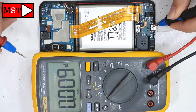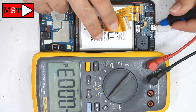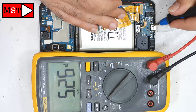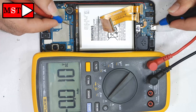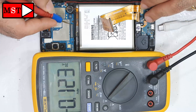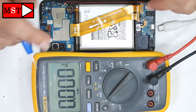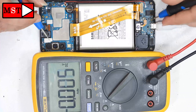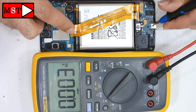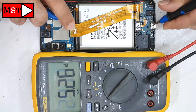It's about zero, so the phone will not charge at all. Let's unplug the connector flex cable and check this side — it's showing 5V but keeps jumping. So maybe the flex cable is not working. You can replace it to see if the problem goes away, or you can do a jumper wire to solve the 5V line issue. Testing again — it's jumping, so it should be the flex cable or there's no connection when we press the flex cable into the mainboard connector.